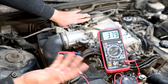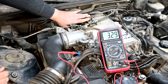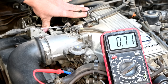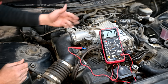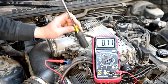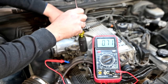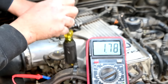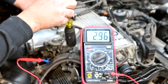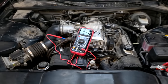At wide open throttle we're at 3.8 volts — there were no big drops or big spikes — so now we're just going to come back down slowly. We came all the way back down, no spikes, no drops, nothing. Here's something that might help: just grab a screwdriver and tap the sensor and see if that voltage changes, and then tap it while you're opening the throttle plate as well. Nothing on the way up, nothing on the way down. I need to dig into service data.